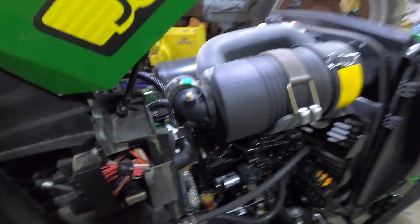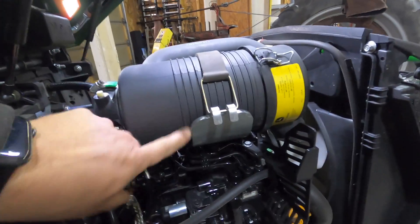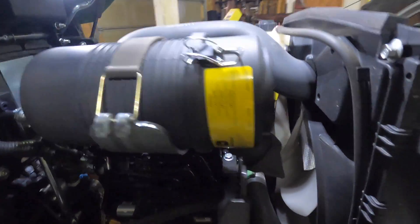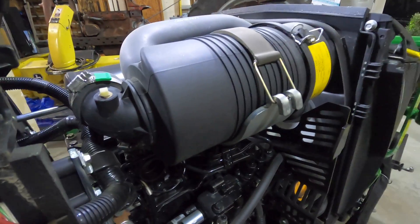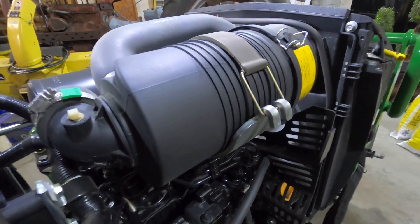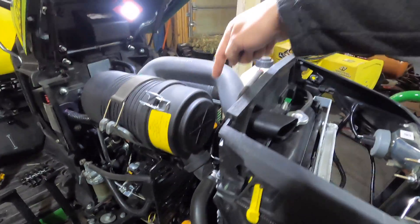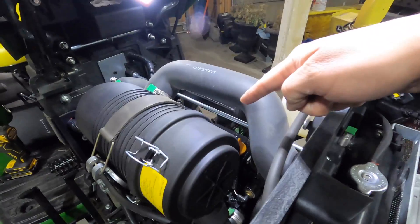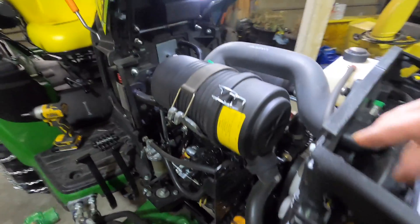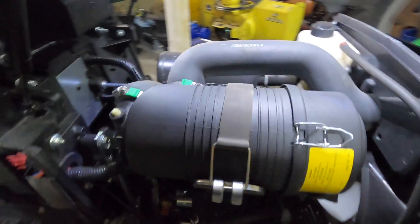You can see that the air cleaner is mounted to a bracket right here. There are two styles of this one. I happen to know that I have the second style released by John Deere — basically the bracket is built thicker. The problem is that these brackets crack. They're attached to the valve cover, and it can crack the valve cover, which then leads to engine destruction.